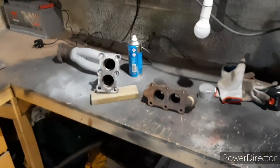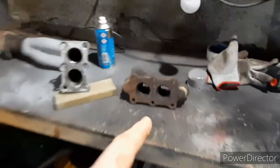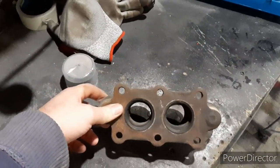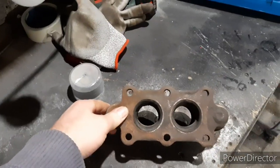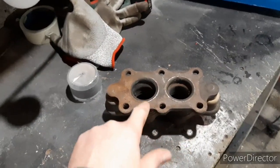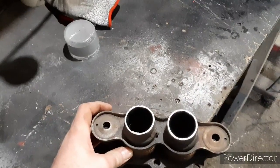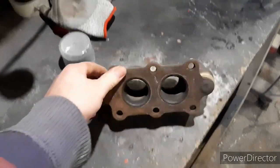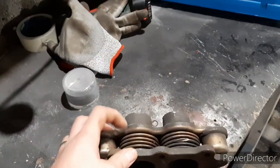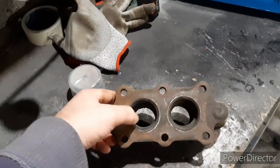Now, this is my downpipe I'm making. This is the standard one. Now, as you can see from the standard one, that's your standard. This is off a Mk2 Golf, but the 16 valve Mk2 is the same. Now you've got the ring, you can just see the ring there. That's the gasket, standard gasket seal, which is 51mm, and then this goes down onto 41mm inside downpipes. What you have got is 35mm inside, where this dips in, where you've got the factory bellows, that's actually 35mm in there. So you're going from 51 into there to 35, then back to the 41 pipe.